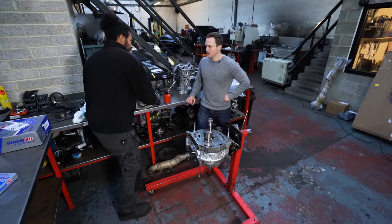Did you hear that pop in there? That is the corner piece breaking away from the main body of the apex seal — they're held down with super glue from factory just so it makes it easy to assemble. All the aftermarket apex seals don't come bonded — they come separate. So you've got another pass and then a final pass.